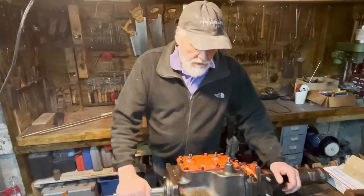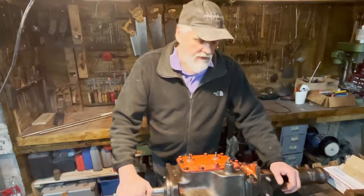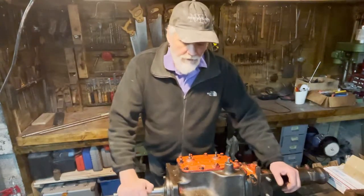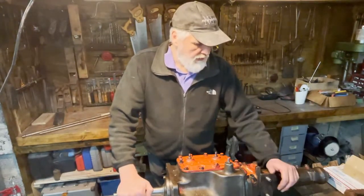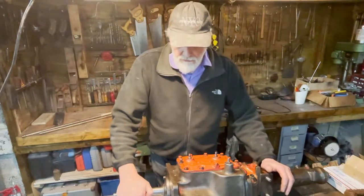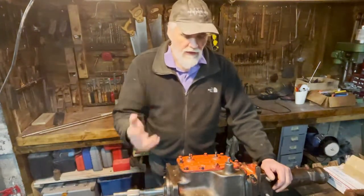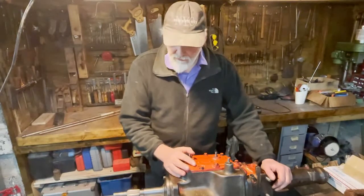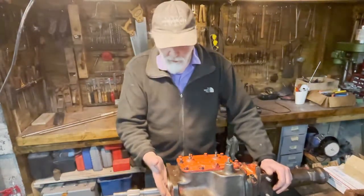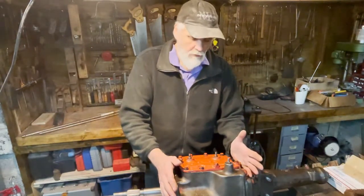This is the four-speed transmission of the Green Challenger. Unfortunately, it needs some maintenance. There is a noise in it, like a bearing rumble. It's apparently when we drive the car and come to a halt that we can hear the sound. It does not make any sound when it's on idle. By pressing the clutch and such, we cannot hear anything. So that indicates that it should not be the input bearing, but probably the output bearing, the second main bearing.